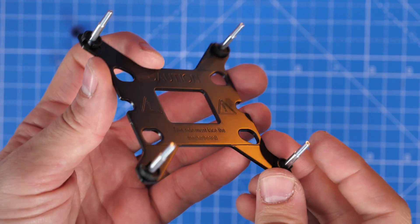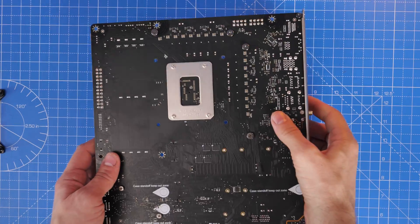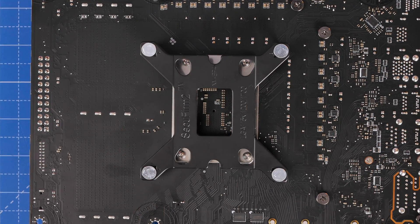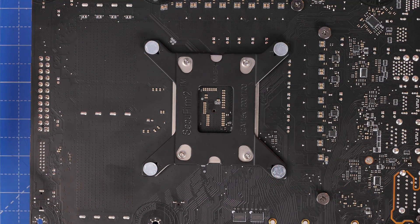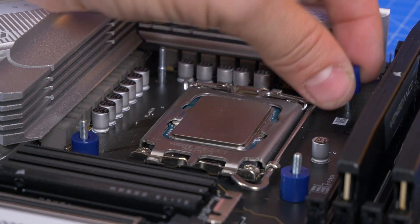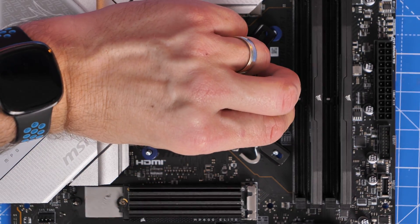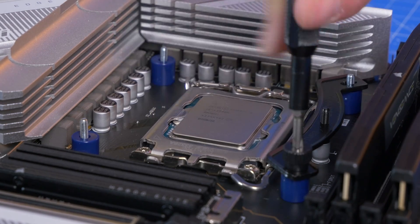The best way to do this is with the motherboard out of the case, unless you have access to the back of the motherboard through the rear of the case. Flip the motherboard over, put the back plate down in place making sure you've got it the right way around, line it up and push it through to the other side. Once it's through, use the blue washers included in the box and put them down over the four screws to provide standoffs for the bracketing. These brackets have markings numbered three, two, one depending on which socket you're using — for LGA 1700 use hole two, the middle hole, then use the thumb screws to secure the brackets down onto the washers.